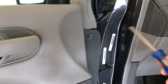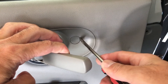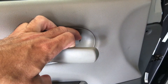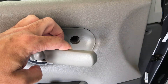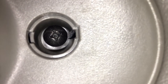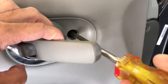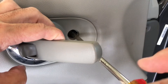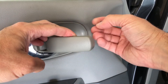Next, pull the handle back to access that tab. Take your flathead screwdriver, slide it right in here, and gently pull that out — you don't want it to break. Pop it out like that, take your other hand, get a hold of it, and pull it out. Inside here is a Phillips screw, and as you can see, that takes the larger Phillips screwdriver because the pattern is wider. So let's get the larger Phillips screwdriver and remove that.